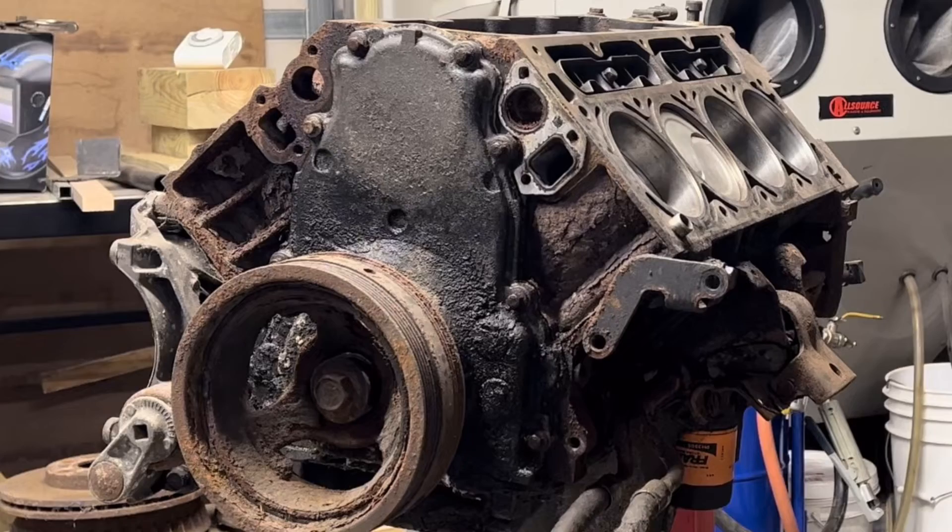Now that our cylinder heads are all done with our dual valve springs, we can go ahead and start the teardown process with the 6.0 liter LQ4. The main reason you want to use an LQ4 for a project like this — especially when doing something with square port heads — is that you can't fit square port heads on anything smaller than a six liter: not a 5.7, 5.3, or 4.8. I want you to take a good look at this now, because when we're done with it, this thing is going to look like a million bucks. Stay tuned for the Type 65 build — we're going to be going rapid fire very, very soon.